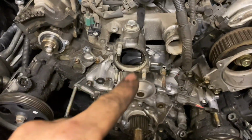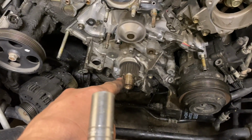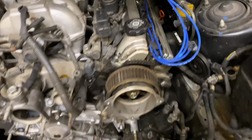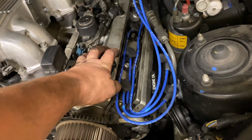So calling it a night here, but what I accomplished, of course, we got our water pump upper housing. We got that cap back there resealed. I threw that back on once I got the crank seal back in. We got both cam seals replaced. Valve covers torqued on. Spark plugs are installed.